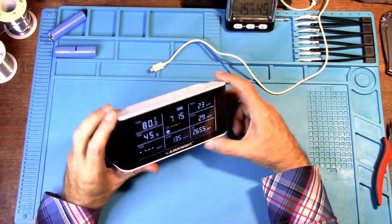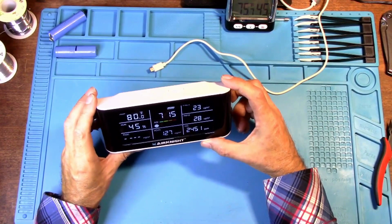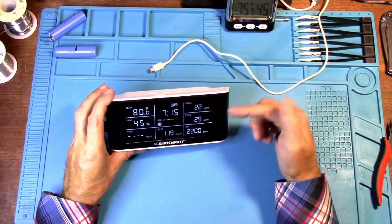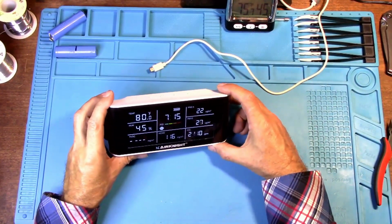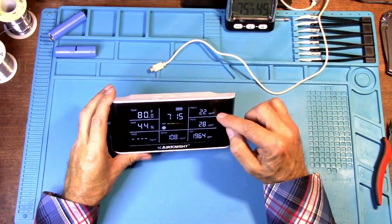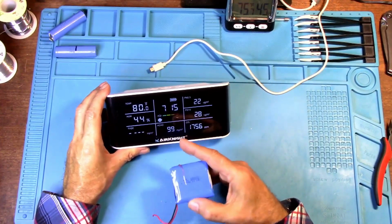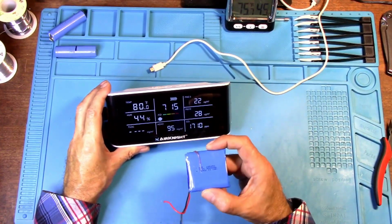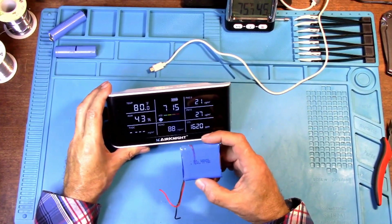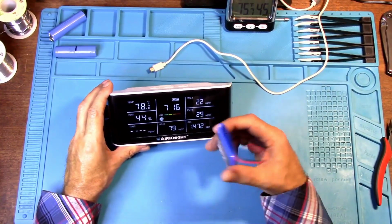Yeah, I really do think also that the 4.22 volts that is going out there, I don't think it's such a big deal. For me personally, I don't see a problem with that even after 2 days. And right now it was even putting out less than 4.2 volts. And 2 days ago, when I first started this test with the voltage, the polymer battery that was in it was completely charged, and it was still only showing 4.19 volts going to the battery. And after 3 hours, it was still the same. It was less than 4.2 volts. After 5 hours, it was still less than 4.2 volts. But after 2 days of sitting here, it's showing 4.22, which to me is acceptable.